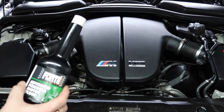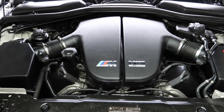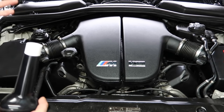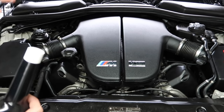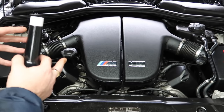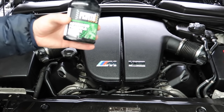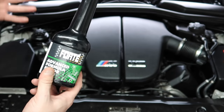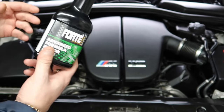If many of you don't know, BMW, Honda, Toyota — a lot of different companies — use variable valve timing. A lot of these variable valve timing systems use solenoids, motors, and springs that advance the timing, and obviously the valve system itself. In those systems they've got a lot of little oil passages where the oil flows through. What this liquid can end up doing is clogging up all the filters inside the solenoids and stopping up the oil passages inside the engine, stopping oil from actually flowing properly.